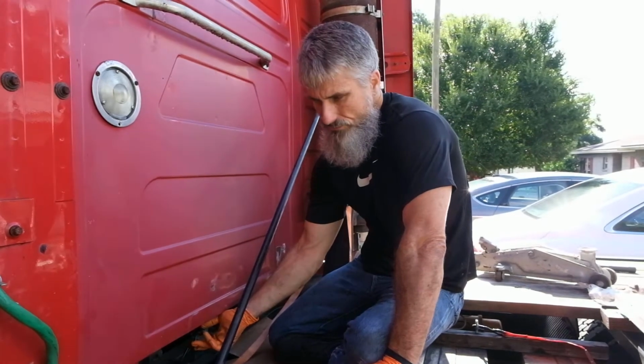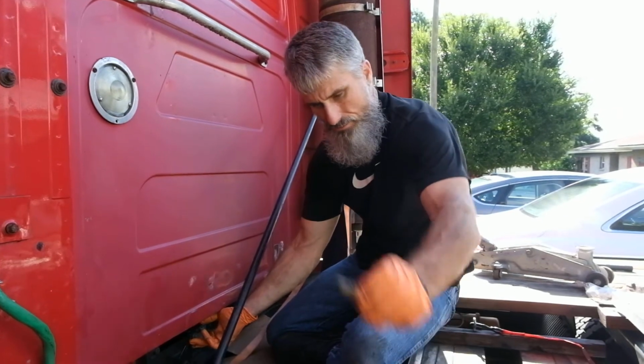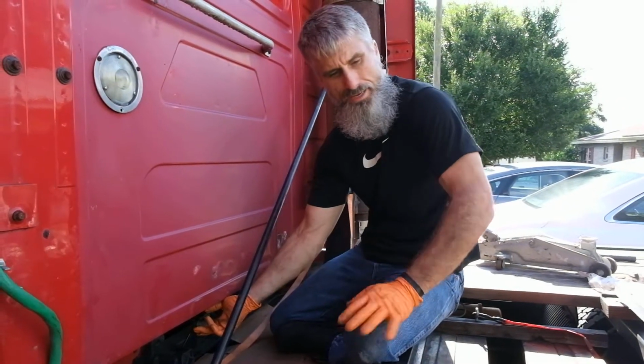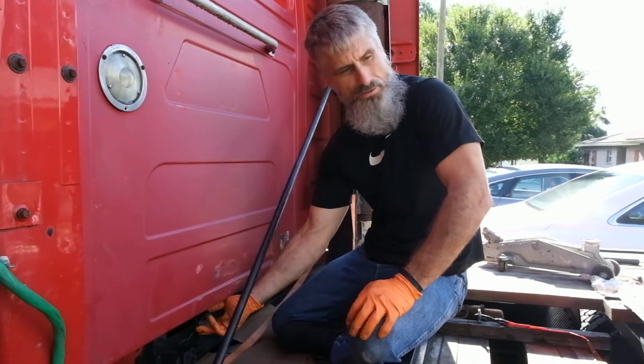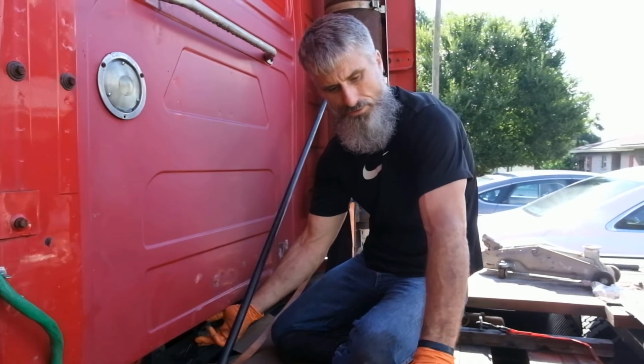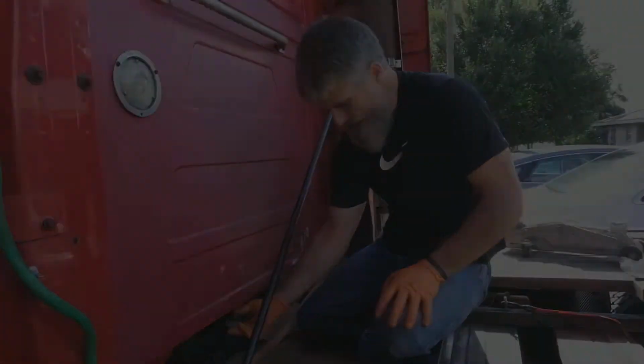And once the pressure is removed, we'll take our patch out, place our fitting with some new thread sealer on it back into the bottom of the bag, check the ends of our air lines, make sure they're clean and ready to be reinserted in the push to connect fittings, air everything up, check for leaks.